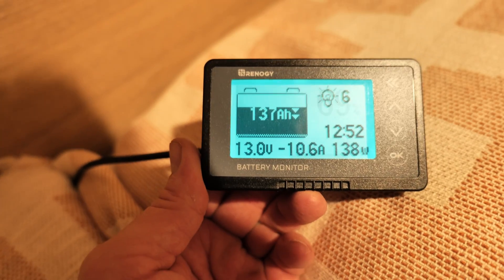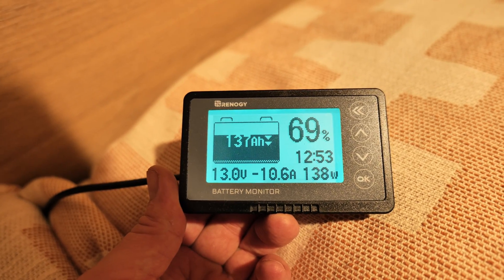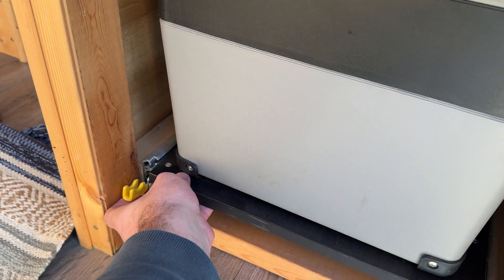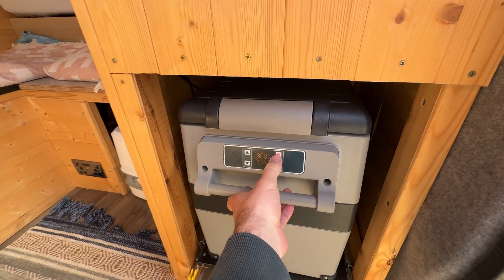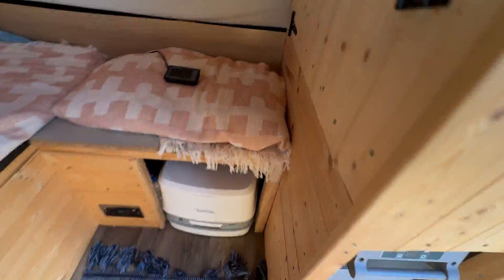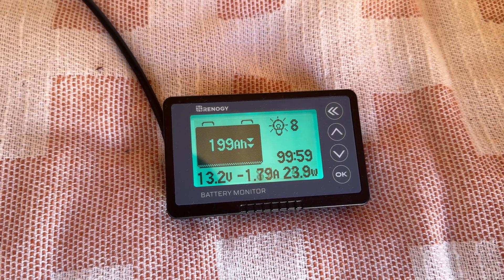The biggest consumer in this van is the diesel heater. When it's blowing steady, it drains about 2 or 3 amps, but at startup and shutdown it will go up to 12 or 13 amps for a minute or so — how often you turn it on or off will affect your power consumption. The fridge is pretty economical too, also using about 2 or 3 amps per hour, but the cold outside temperature helps since the compressor doesn't need to run as long. In summer, the fridge will run more, whereas in winter it's just start-stop as it quickly reaches the desired temperature. The lights are probably both combined pulling a maximum of 1 amp, so not a great deal.